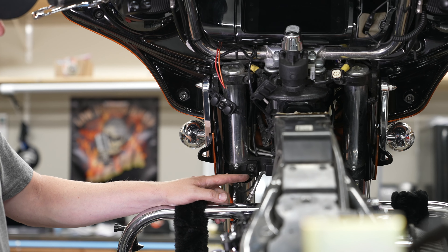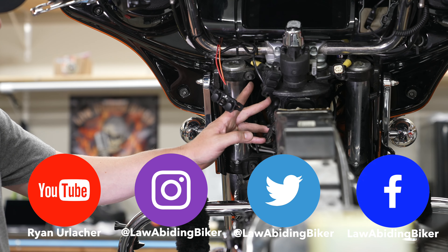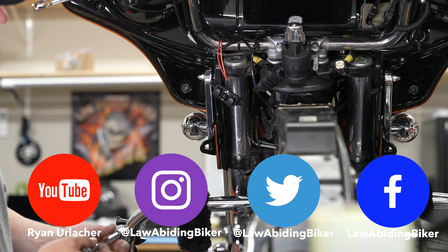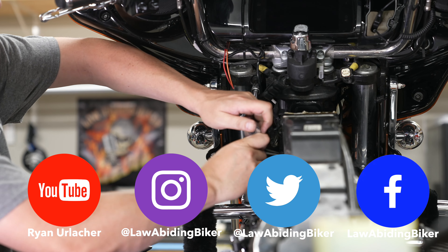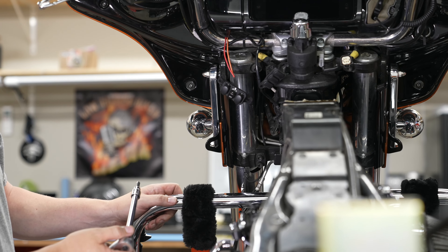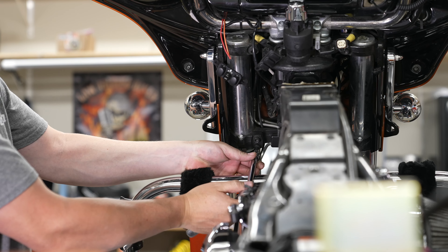Now there are two sets of clamps. You've got your mid clamps for the forks — two bolts down there — and then at the top there's one bolt that clamps the fork into position. That's a quarter-inch hex head and he's going to go ahead and break that top one and start backing it out. No big deal because you've still got your mid clamps supporting the fork, so he'll break those and get them started.